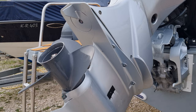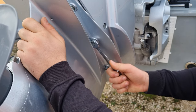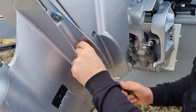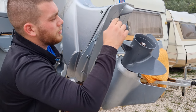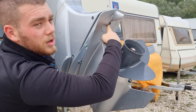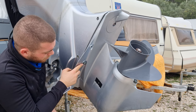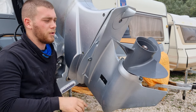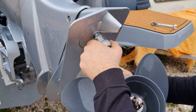Let's remove the lower unit. There is gonna be some resistance on the bolt, so don't be afraid to undo it — it's not a problem. When you finish undoing six bolts for the lower unit, you will need to undo this one inside the case. Leave this bolt hanging about 50% out so it doesn't fall on the ground. If it falls, they are usually stuck. We need to remove the flap — the socket is 14.